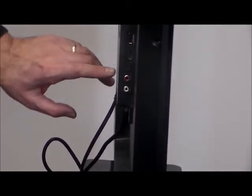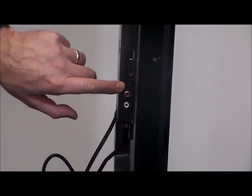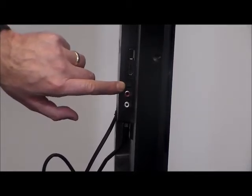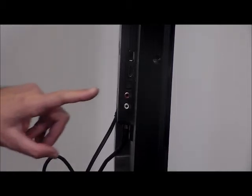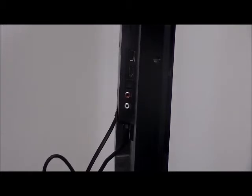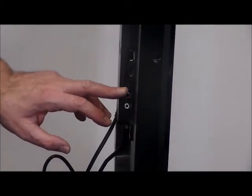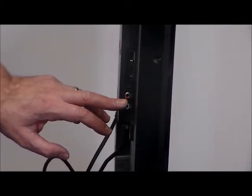You also may have what's called an optical out — that's a digital out designed mostly for surround sound, but that's not really what you want. You also may have a digital out that looks something like this but brown. We have converter kits that'll work with those digital and optical outs. But what you'll ultimately need to make these hearing impaired speaker systems work is a red and white RCA audio out or a 3.5mm audio out.